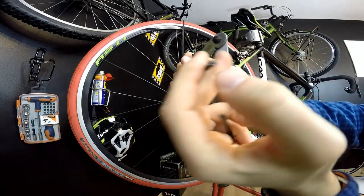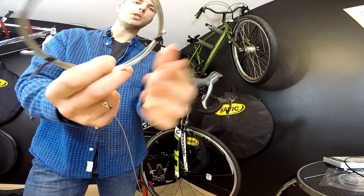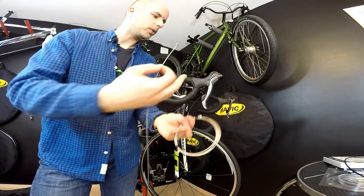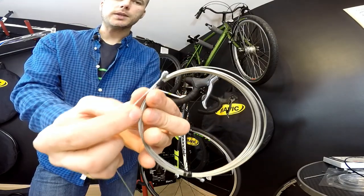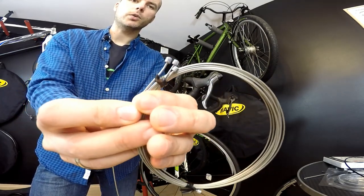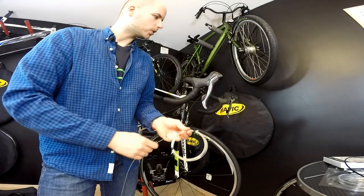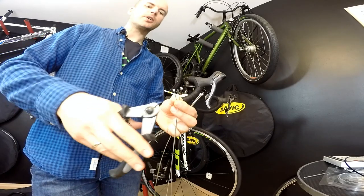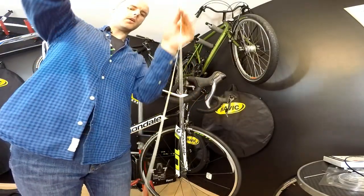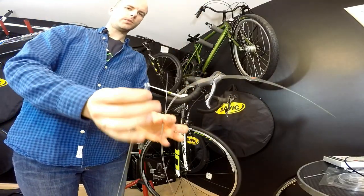Very nice edge — open and clean. The cable endings are Campagnolo-specific and Shimano/SRAM-specific. The Shimano/SRAM end is larger; the Campagnolo end is smaller. If unsure, compare with an old cable from your bike. I'm cutting off the Campagnolo-specific endings and going with the Shimano/SRAM ones. Also note: the longer cable is for the rear derailleur and the shorter one is for the front derailleur.